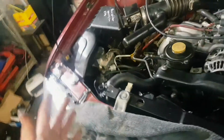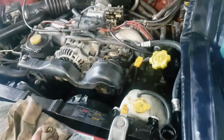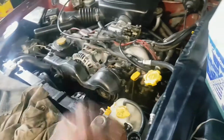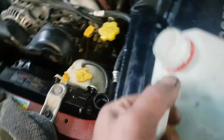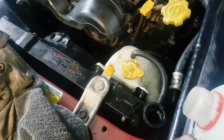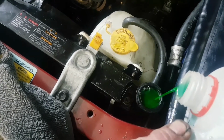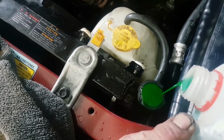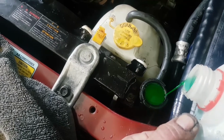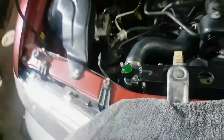Okay, so after switching the engine off, even though you saw it bubbling up, the engine will continue to take considerable amounts of coolant. Heater valve on. Okay. This is funny. Left hand. See how it continues to take coolant? Lucky I had a, as in previous videos I've mentioned, here we are. So we are finally done.